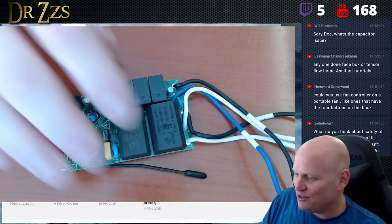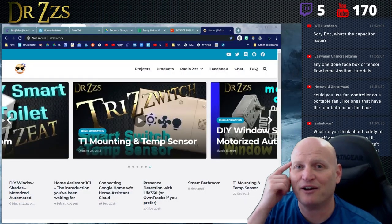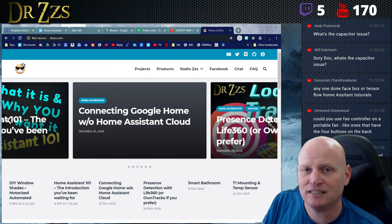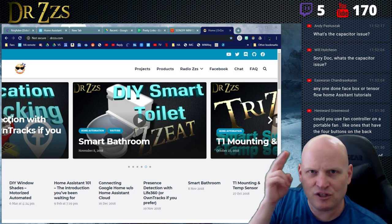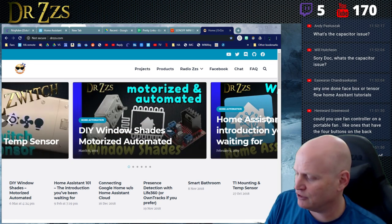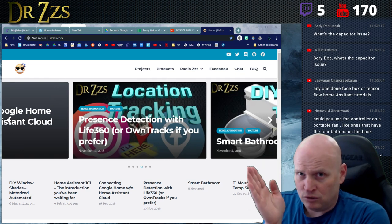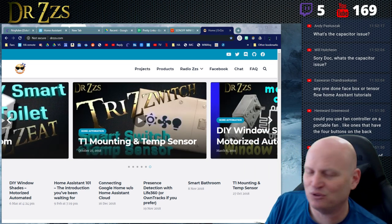I want to tell you a fun story. If you looked at the Sonoff Mini video that I put out this morning, and I say this morning because I put it out at like 3 a.m. But here's the fun backstory. The capacitor issue, Andy, is that if you connect this Sonoff's fan modules to a fan in the U.S., the fan in the U.S. already has some capacitors built in. When you add that to the capacitors this has, and the capacitor is what varies the speeds, what you end up with is three speeds on your fan: slow, barely moving, and nothing.